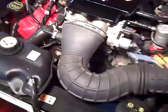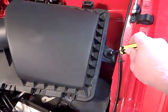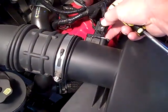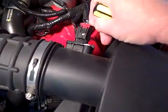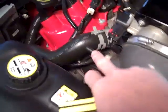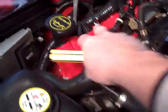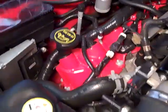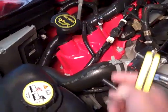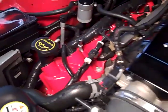This is pretty simple. Basically, you're going to loosen up this clamp right here, remove the 10 millimeter bolt right here, unplug your mass air meter, pull this red tab out, squeeze the clip, and that comes off. There's also a PCV line that goes from this fitting to the valve cover. This one's already been removed. There's two little tangs on here, two little green plastic clips — pull those clips and remove it right from the valve cover.